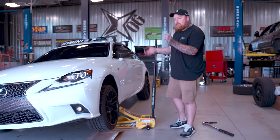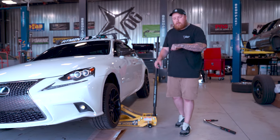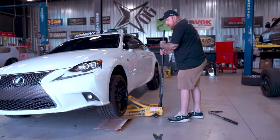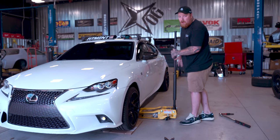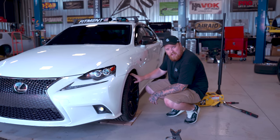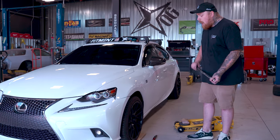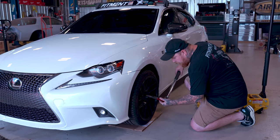We're going to lower the car now. We know the wheel moves freely and we're all good, so we're going to lower it onto this piece of cardboard nice and slow to make sure the wheel is not going to hit the fender or anything like that. We'll do a little turning test too to make sure we've got the clearance we need. Test all this before dropping it, because you don't want to nick the wheels. Now that the car is on the ground, we're going to torque it down. This car specifically is 88 foot-pounds, but make sure to do your research and look up your year, make, and model to find the correct torque — it's different between makes and models. Always torque on the ground, not while it's in the air. We're going to use that star pattern again and torque each one to 88 foot-pounds.